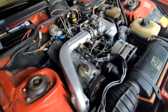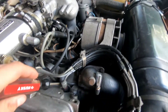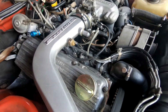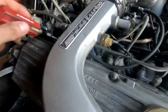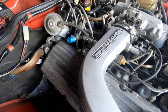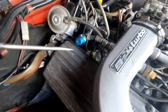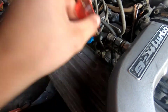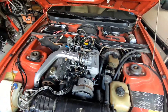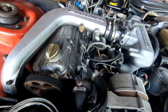It looks like my theory was correct. I didn't really get anything on the first cylinder. The second gave me a tiny bit of a response when I sprayed on there. The third one really gave me the most — the revs almost evened out a little bit, almost sounded a little bit smoother. The fourth one also gave me a little bit. So this is an easy way to test whether or not you have an intake manifold gasket leak.